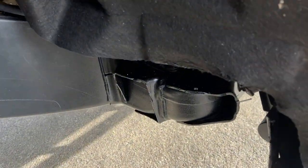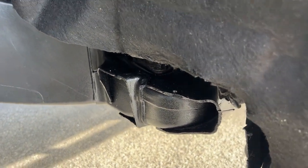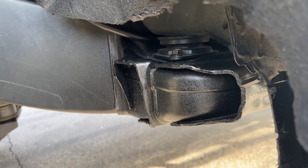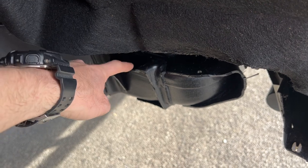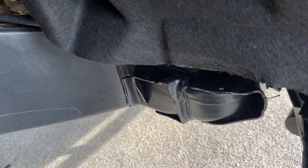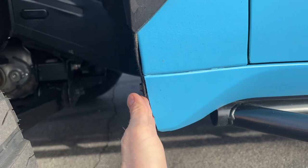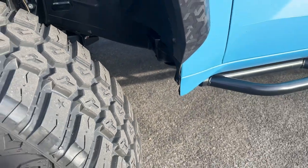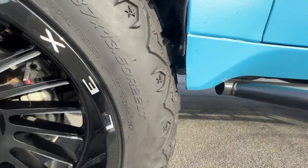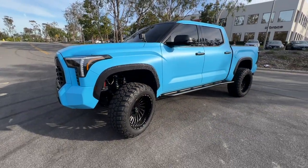Let's see how she looks after the trimming — looking absolutely amazing. I hit it with bed liner as well to give it a nice textured black finish and prevent any rusting. It came out amazing. In the future if I want to weld a plate on, I'll probably need to do a little more cutting here and mold it to the shape of that curve. I also trimmed back the skirt a little bit using the side of the cutoff tool, shaved some off, and rounded off the bottom to push it back so we don't hit that skirt either. With the wheel turned all the way left, there's incredible clearance back there now — that's what it'll look like inside on your 22-23 Tundra if you're fitting some giant tires.